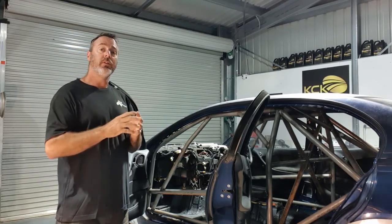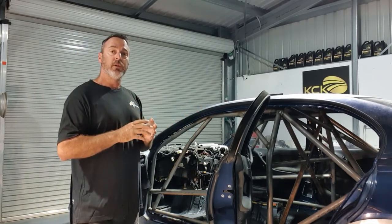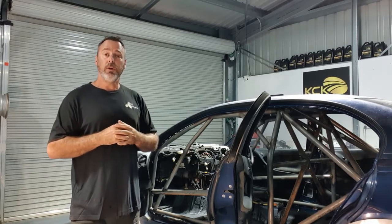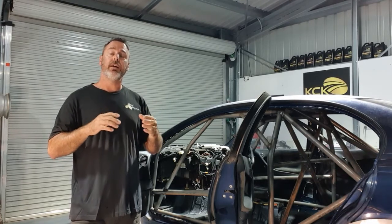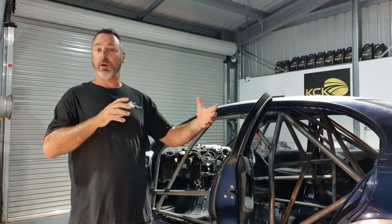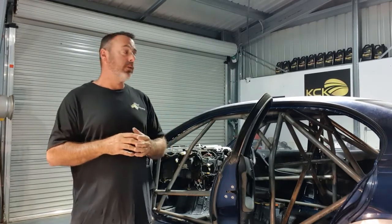The reason we do this is so if there's any pulling or stress while it's being welded, it's not transferred to the chassis. We can wait until the complete structure is finished inside the car before we attach it to the chassis. We've had quite a few cars come in with weight jacking issues or that can't be corner weighted because the chassis has got a set in it from the roll cage being welded in during manufacture. It puts a lot of stress on the chassis as the roll cage twists during welding — depending on the order of the welds, it can transfer that load to the chassis and give you a heavy corner weight you'll never be able to adjust out.